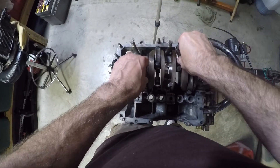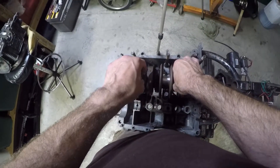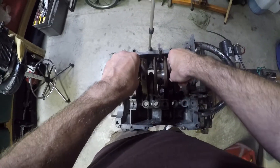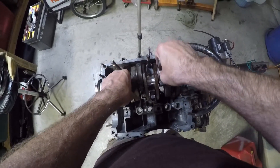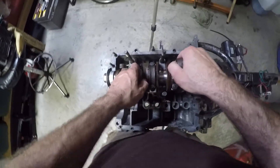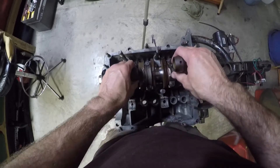We'll just give it a good once-over. Now what we've got here is, I believe it's a 74mm crank, so what we need to do is rotate it around and check to make sure that it's not hitting on anything. Sometimes these cranks will be big — usually it's going to be in the rod end cap that hits. But it looks pretty good. I'm not feeling it rub on anything. A little rocker back and forth — she clicks back and forth.